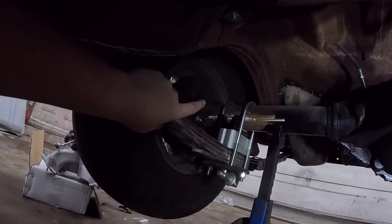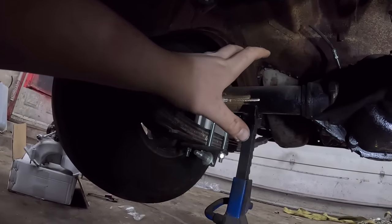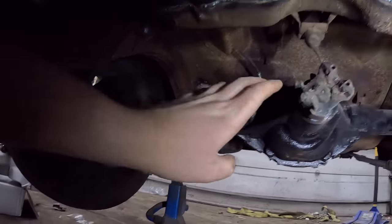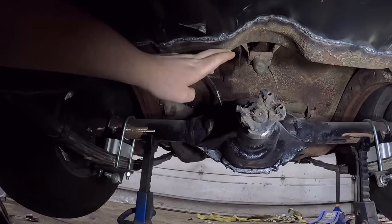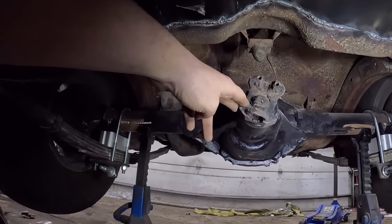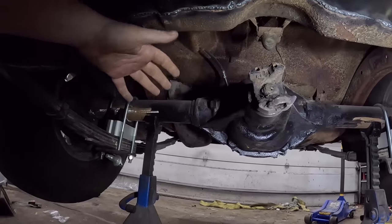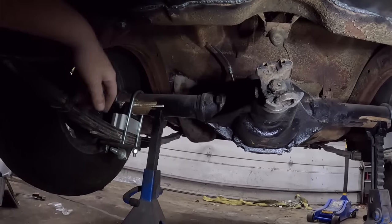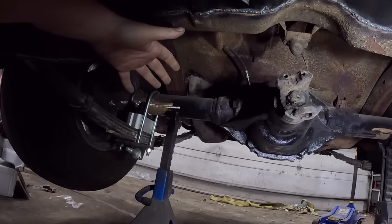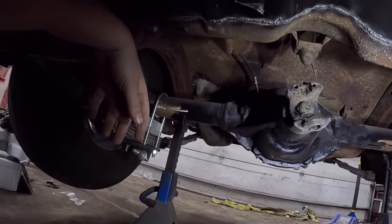So, unfortunately, we have it supported on the rear end, so we do have to screw around with that. And when you are checking your angles and all that stuff, you want to make sure you have the weight on the vehicle. So right now, it's on jack stands, basically at ride height. Motor and transmission are in it. I mean, it doesn't have a tank of fuel and all that, but let's be honest, it's basically 90% of the way of sitting how it's going to sit. There's an interior in it. It's missing glass and a fuel tank full of gas. So we'll call it good enough.